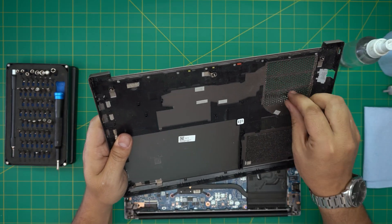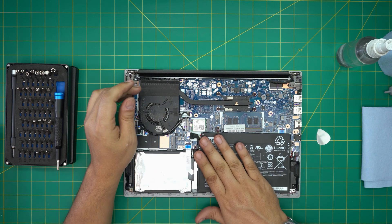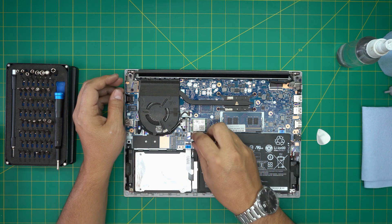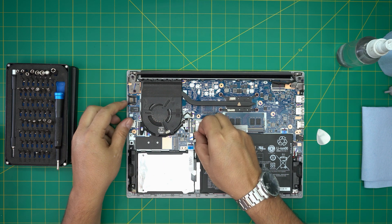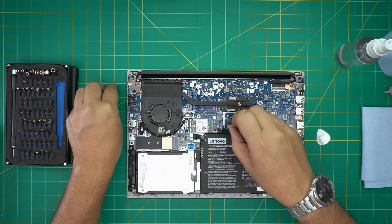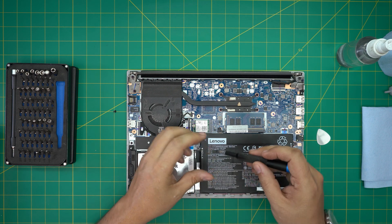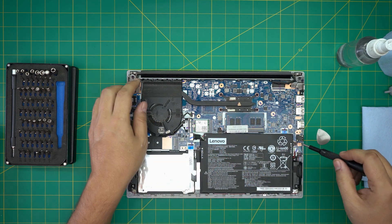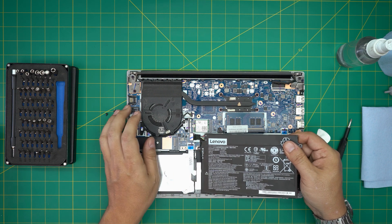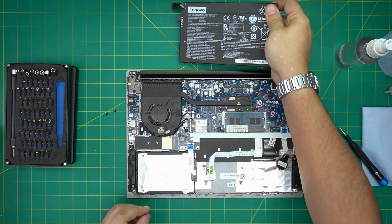This is the bottom cover — you can see it is very dusty with little crumbs. Take it outside, blow some air, and clean it with a toothbrush. Inside we can see the motherboard and everything else. There's a large battery — 11.1V, 3980mAh. To disconnect it properly, don't pull on the tape backward or you'll damage the cables. Remove the small black screws holding the battery, slide the battery this way, and the jack will release. Put the battery to one side.